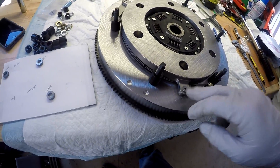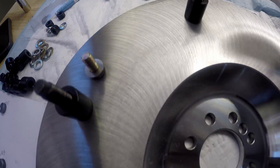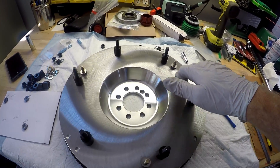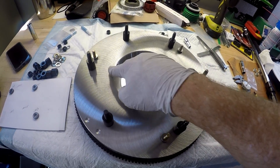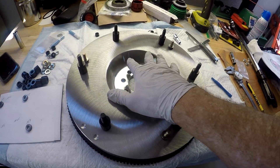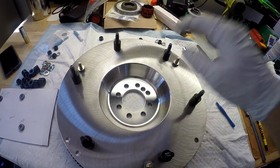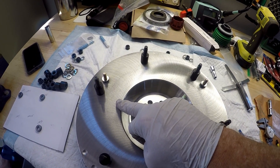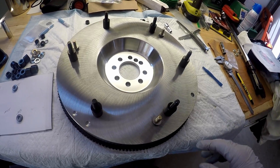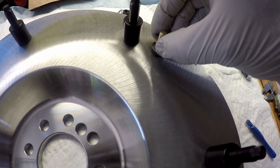They have a few too many shims underneath the straps here. You can see the nice surface finish the machine shop put on. This flywheel was high-centering along the center before grinding — kind of dome-shaped, not a lot, but enough that he felt it with a straight edge and knew he needed to grind it. As soon as he put the grinder down it started taking material off the center but wasn't touching the outside. I'm glad I went ahead and did that.